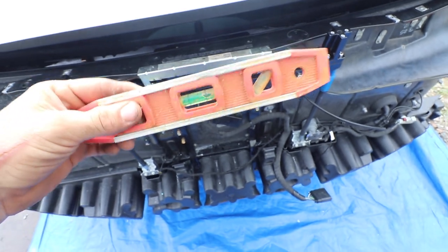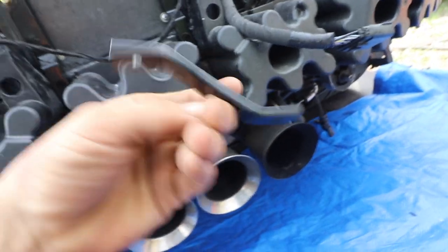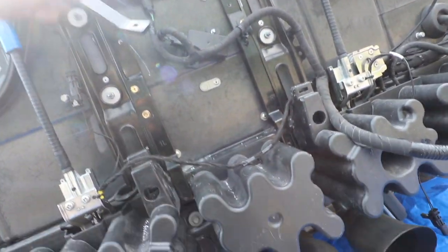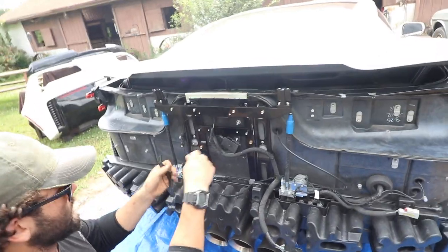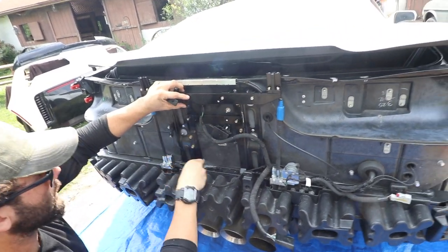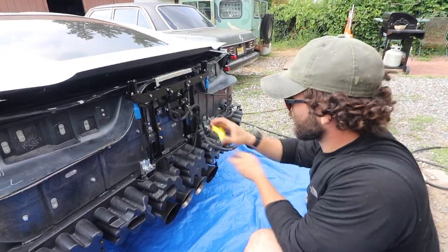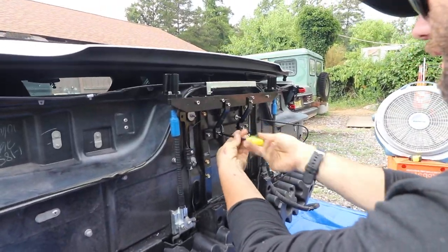As you're doing this, make sure all this stuff is level, use a torpedo level. Next thing we're gonna mount on there is the H-bracket, but it's gonna go right there. And then you're gonna use the five. You're gonna put them up here. You're gonna mount in and use these guys again. Let's grab these and mount in like that. And then you can tighten them all up once you're done with that. That's what it's gonna look like once you get this all mounted up. I'm just tightening the remaining two.